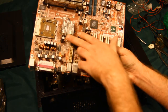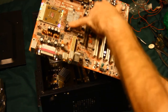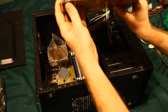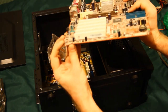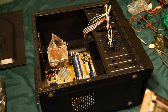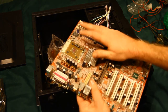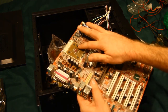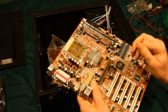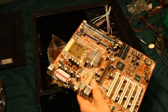And that's not a 3200 — I had to correct myself. This is a 2500, but it's still a Barton core, and it will easily overclock to the 3200+ rating. I can't remember the exact gigahertz for that, but pretty much every 2500 would overclock to 3200 — and this one did, because that's how I ran it.